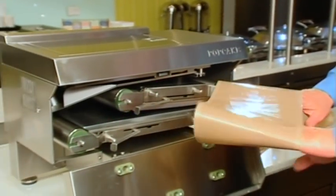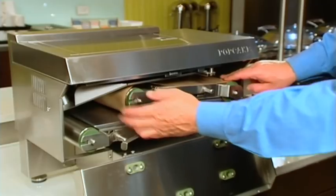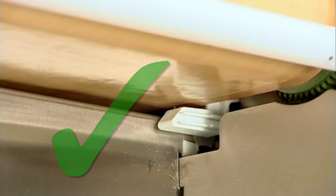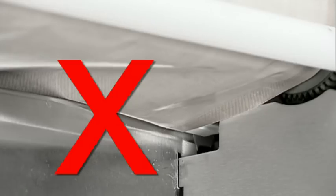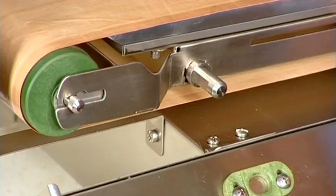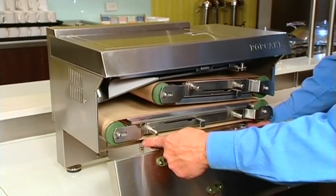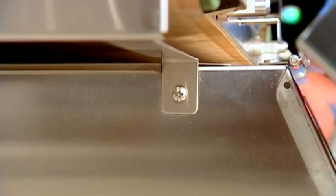Guide the belts over the rollers, starting at a 45 degree angle. This method ensures the belts will slip over the rollers with ease. A belt sensor is located inside the machine. The lower belt must be inserted between this belt sensor in order for the machine to operate correctly. Incorrect placement of this belt can cause damage to the machine. Once installed, slide the tensioning lever back to tighten the rollers. Then replace the white rollers and reinsert the crumb tray. When replacing the crumb tray, it's very important to make sure it sits in place perfectly, otherwise this will interfere with the operation of the belt sensor. The lip of the crumb tray should sit firmly over the side of the machine, securing its position.